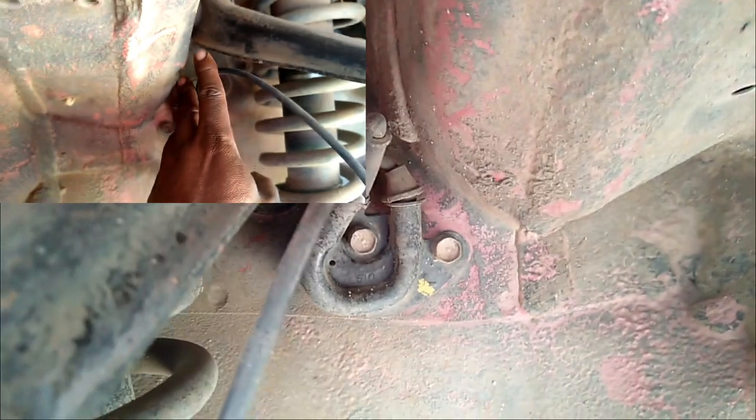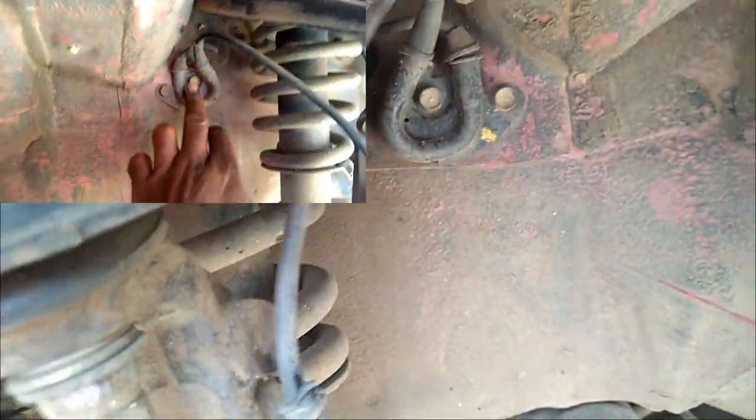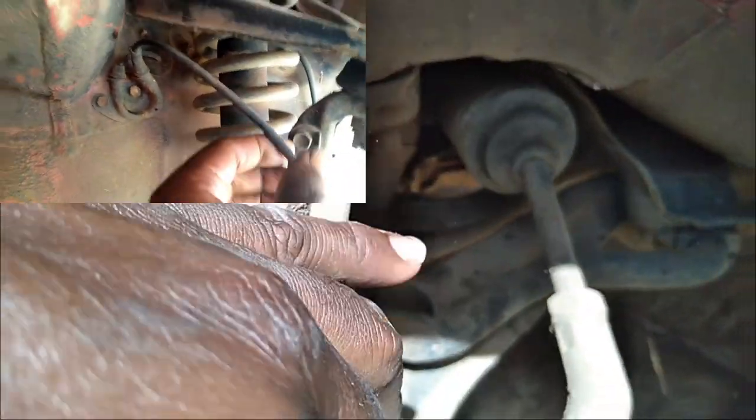What I'm doing now is inspecting the cables, which seem to be okay — there are no open circuits on the cables. After that, I have to get access to the speed sensor readers. You can see there's a lot of dirt around the rings — that's the speed ring.